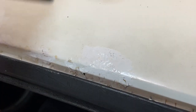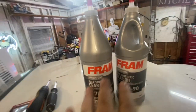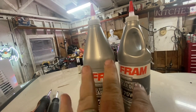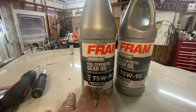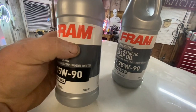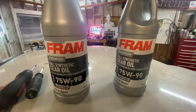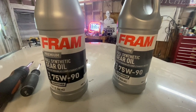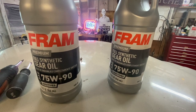Here's my touch-up result — it's not perfect, but it's not rust anymore. It dried up really good and really hard. The next thing I'm going to do is try to deal with the transmission gear grindage going on. A Toyota mechanic I know told me to get some 75-90 gear oil with a limited slip additive in it. Yeah, this has plus additives, and he said that can help that situation. I'm also going to check the throw on the slave cylinder to make sure the clutch is functioning properly. I'm sure it's going to be synchronizers in the transmission, or maybe it hasn't been serviced in a long time and needs some fresh oil — you never know with these finicky little Toyota gearboxes.